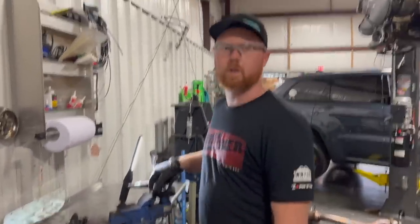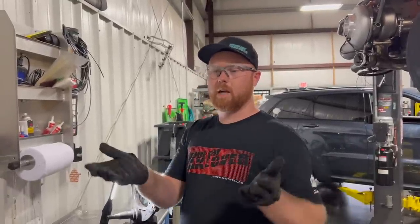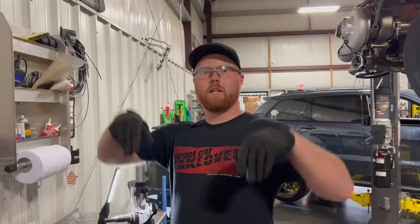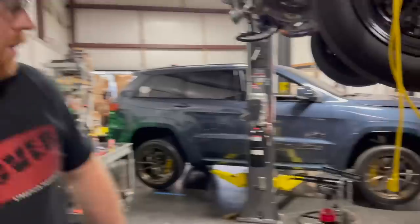And then there is a little bit more cutting on the frame for the lowering, kind of where the pocket is for the control arm. You have to trim it out because the control arm can go so much higher. Oh, it can hit the frame. Yeah. And there's a crossbar support it can also touch. We can show them real quick.